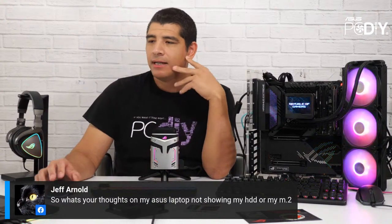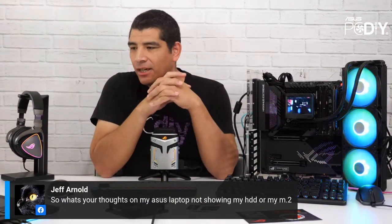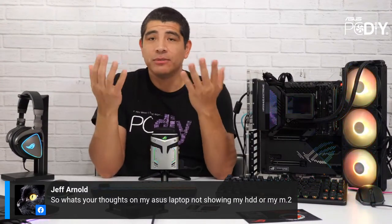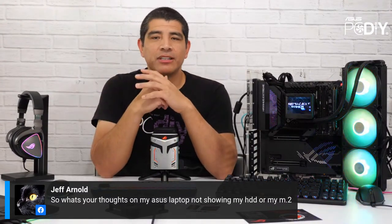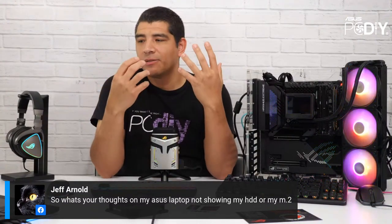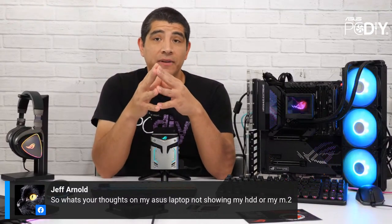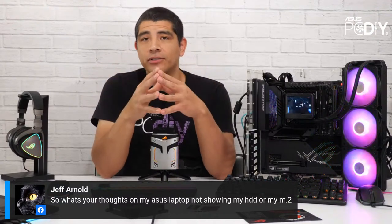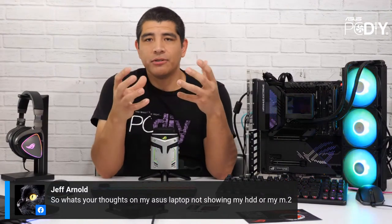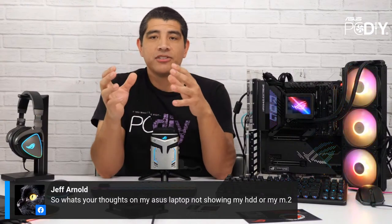Hey, Jeff, just asking, what are your thoughts on my ASUS laptop not showing my HDD or my M.2? That can really be quite variable. When you talk about drives generally not being detected, it can be a number of different things. But initially, especially if your HDD is not showing, I would probably say it's because the drive has failed or has some type of fault. This can happen for a number of reasons. It could be the cantilever, the internal mechanism, or the internal PCB board has some fault or issue and it's no longer recognized.